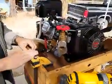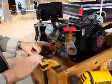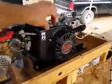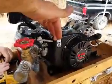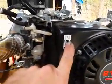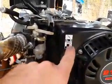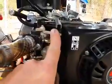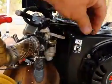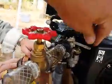So we've established that we have spark for the system. We've also established that the throttle is all the way on, which is that direction. And you can see from the label on here that the choke position needs to be in the run position and the throttle needs to be all the way in that direction.